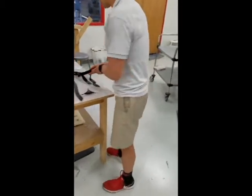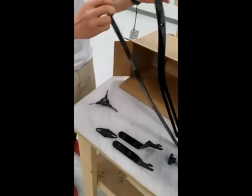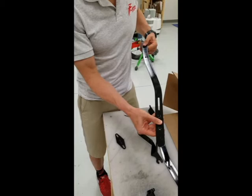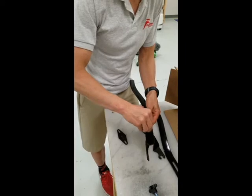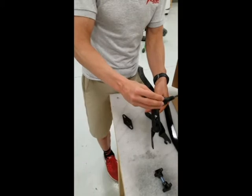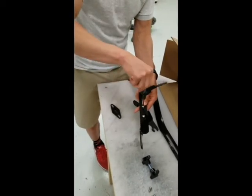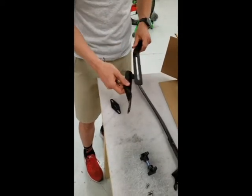the next thing I'm going to do is assemble these pieces. The hard part is you have to remember the right orientation. If I know this is one side of the leg, the attachment comes here. Then I grab one of my 6 bolts that all look identical, and I run them in through the top, into the threaded inserts on the back of this. I'm going to tighten these so it's still loose and slides up and down, because you'll need that height adjustment the first time you install this. So that's one side, this is the other side.